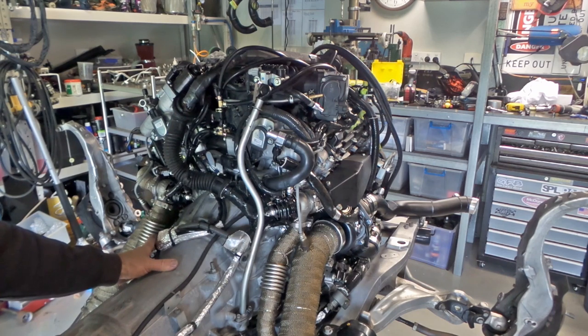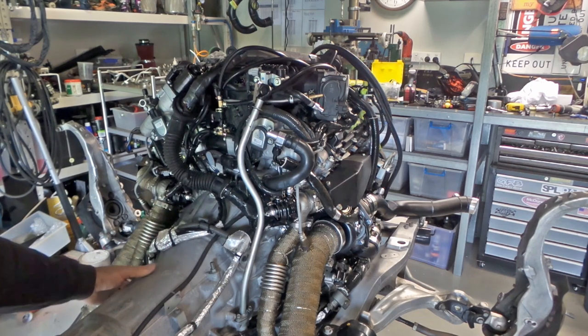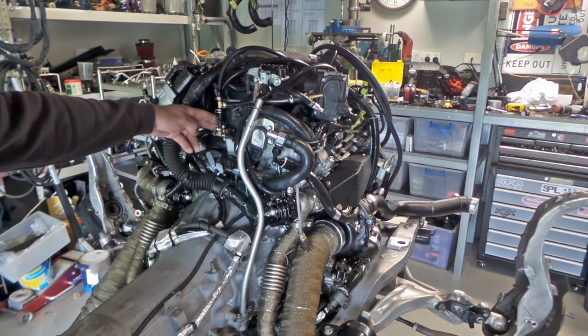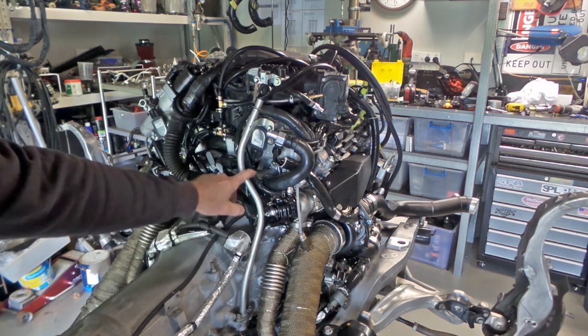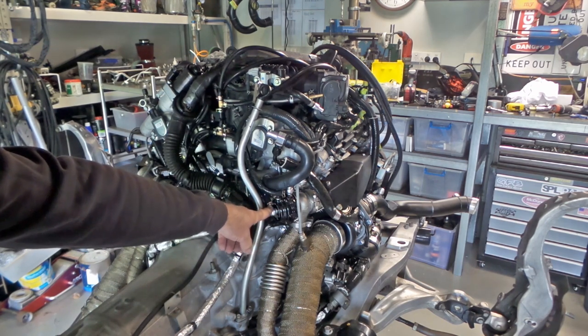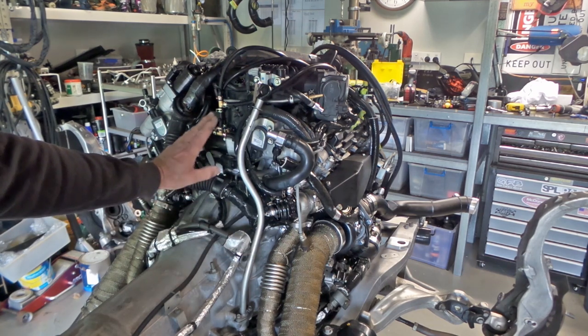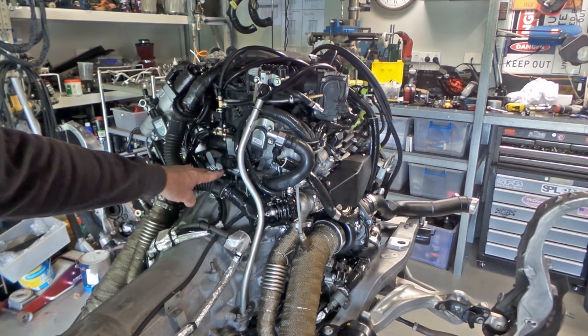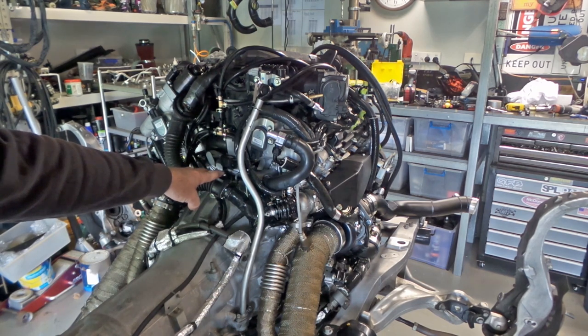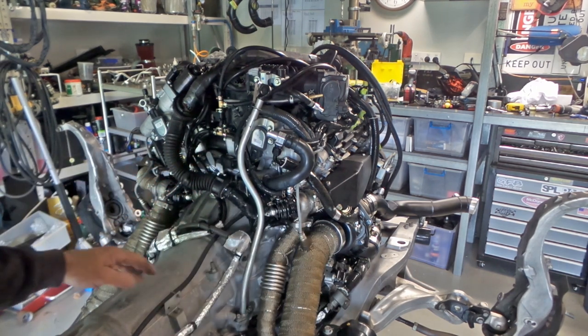Also, a lot of heat sleeving required over here because of the closeness with that wiring to this wastegate pipe here. You can see up here, this is all the vacuum lines for the wastegates that all run down here. They all have heat sleeving. All the hose has small spring-loaded clips fitted to it. Everything is tied back with cable ties, which is an absolute must. I don't know what you'd do without cable ties to be able to just pull everything in nice and tight.